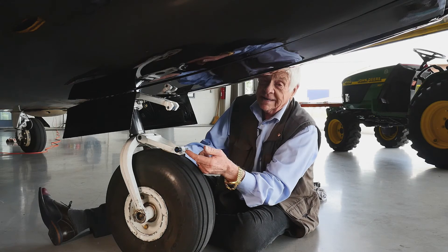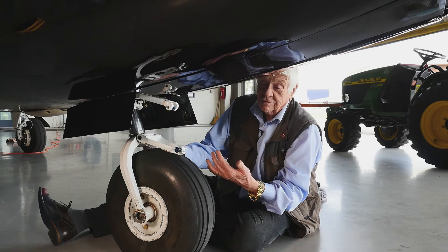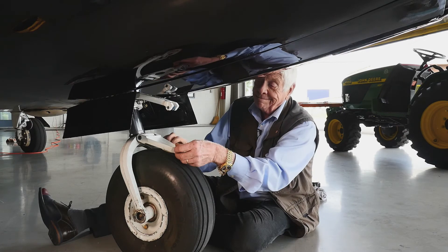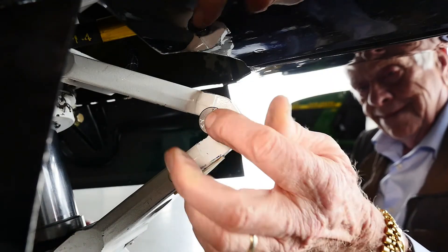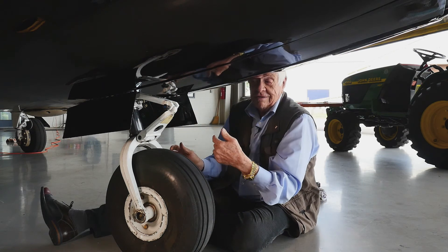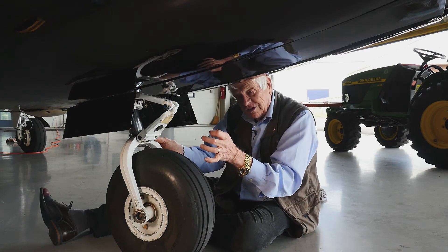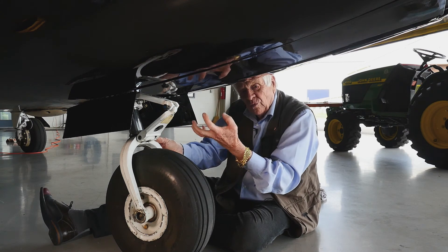If you were insane enough to forget to put the pin in when you get in the airplane, the nose wheel steering test — which is a mandatory pre-flight item — would fail, so you'd know something was wrong. Put it in like that, insert the pin. Sometimes you have to look through to make sure you get it lined up. There's virtually no clearance in these bearings — they're not tight, but you don't need clearance because you don't need grease, so you can make the whole assembly more rigid than even the stock metal bearings.